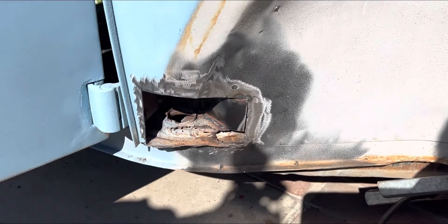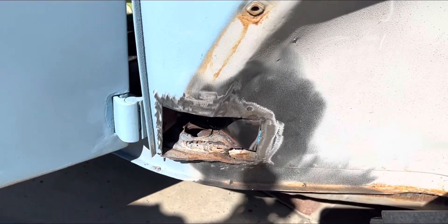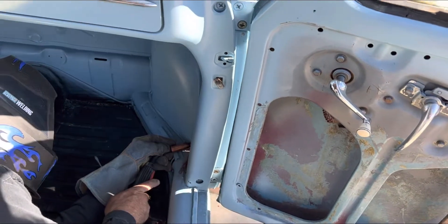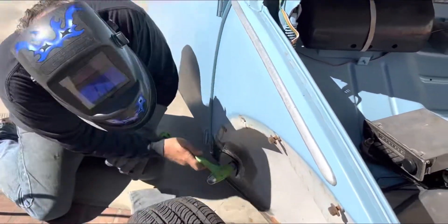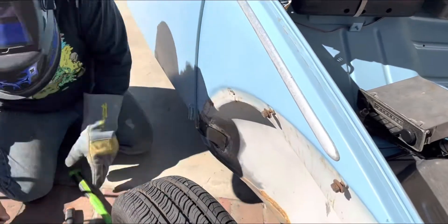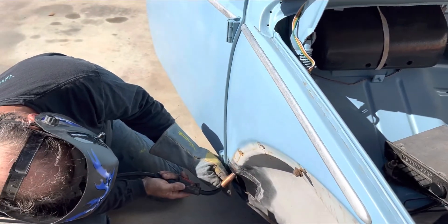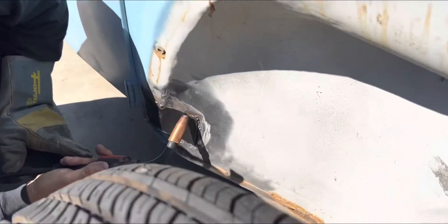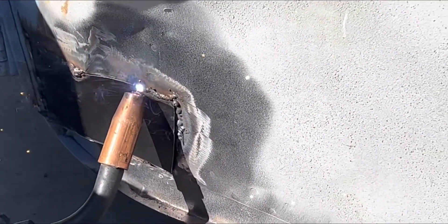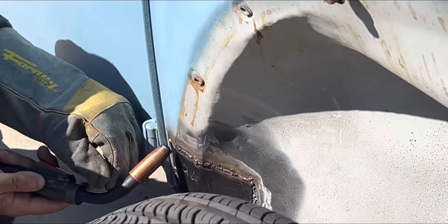As you can see, we got a little bit of a hole cut in there. We've got a couple pieces of metal that are going to go into place, and right now Paul is working on welding it from the inside. From here it's just a matter of trimming up the piece, tapping it into place, and putting in a couple of spot welds until we go ahead and stitch weld the whole thing inside and out. We're going to make sure it's sealed up as nicely as we can so it'll take minimal grinding, and then maybe a little bit of seam sealer before we go ahead and undercoat it.